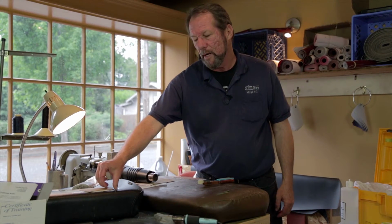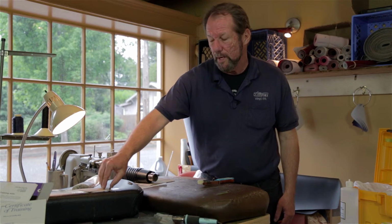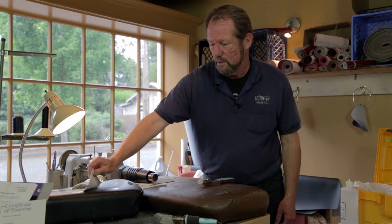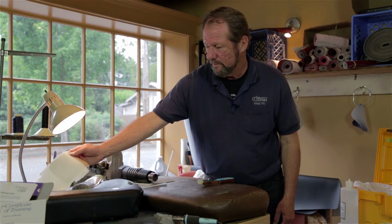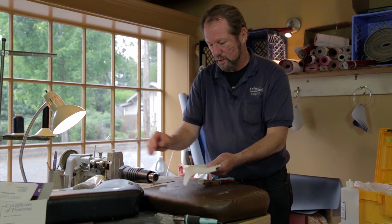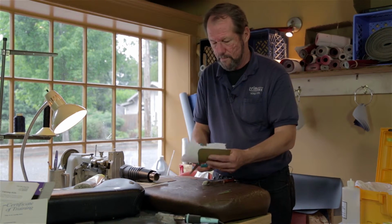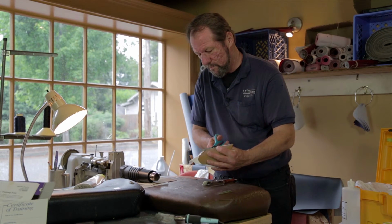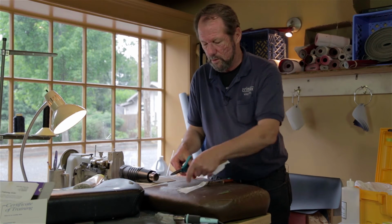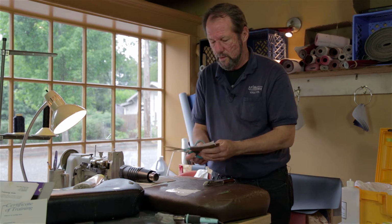That is one of the easiest repairs to do of vinyl delaminating. So the rubber compound and the hardener that we mixed and spread in order to make the mold of the seat pattern has hardened. You peel it off, and you've got the perfect duplication of the grain. I'm going to take this and trim this off, and I'll show you what I'll do with this at a later point.